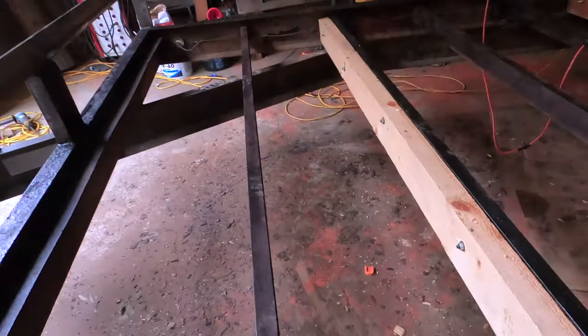For me, I can just manufacture whatever I want, so I'm going with inch-and-a-half on the edges and then full one-and-seven-eighths full thickness on the rest of the deck. I'm just going to give it a kind of cedar stain, which will make it kind of orange in color and should help preserve it.